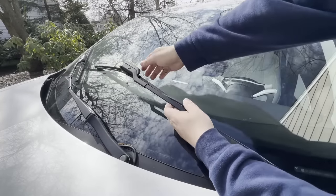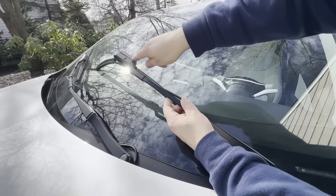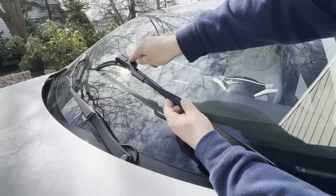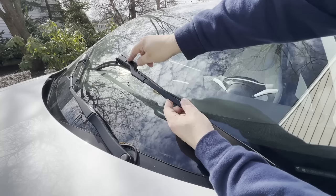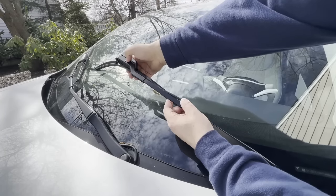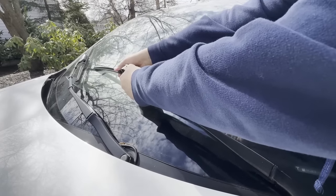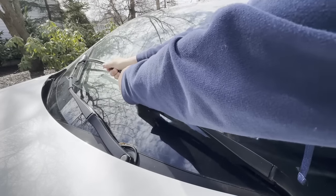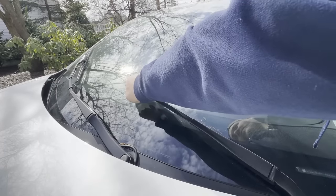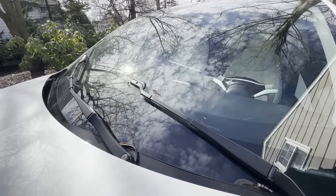When you get into removing your wiper blade, this is your windshield washer sprayer, so be careful not to damage that. It's a little tricky to remove the blades — you're going to press down on the release here. Just be careful not to let the arm snap back onto the glass. Hold onto that; do not let that go because it will pop right back down and you will get a nice crack in the glass.